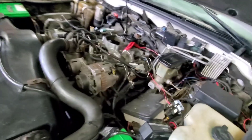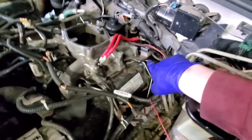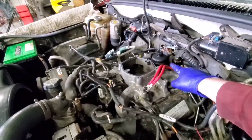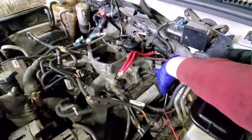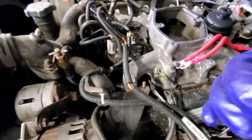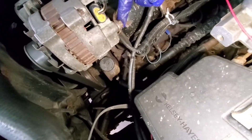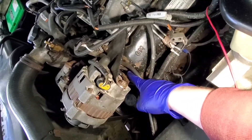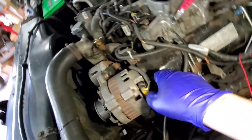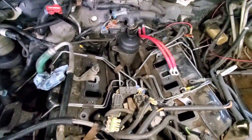Next we're going to remove the bracket from the back side of the alternator - you do not have to pull the alternator. I already popped the vacuum lines out of the boost sensor. To get the fuel bowl out there are two 15-millimeter bolts. The sensor is on a bracket with two 15-millimeter nuts. There's also a 13-millimeter bolt here and a 15-millimeter nut and bolt, so remove all four of those and this bracket will pop right off and get out of the way, exposing our lower plenum.